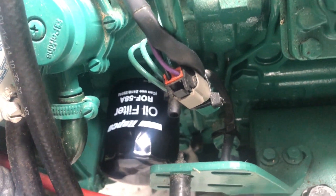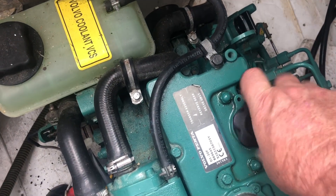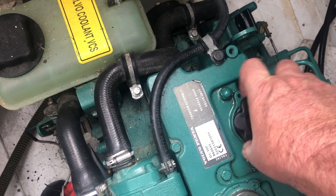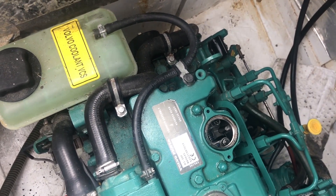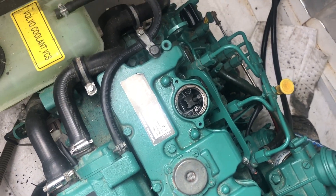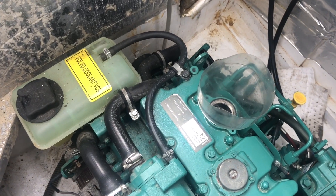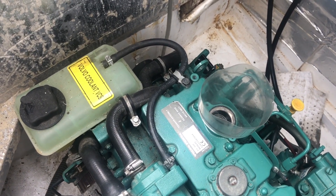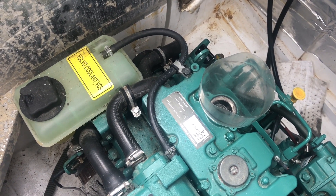Replaced and done up hand tight, and we need to refill it. You need to be careful because it doesn't drain from the galleries that quickly, so it's very easy to put too much in at once and overflow. This is a plastic soft ring bottle — I found this is good. It stays in place and also limits how much you can pour in at once.